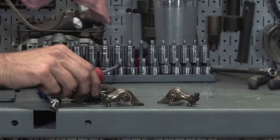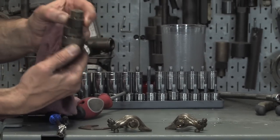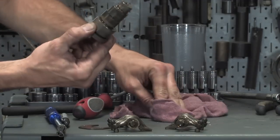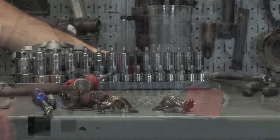If you suspect a lot of wear, there's actually measurements for the lobe height and actual base circle of these cams in the factory service book. But they're definitely in serviceable, usable condition. So we'll go from there with those parts.